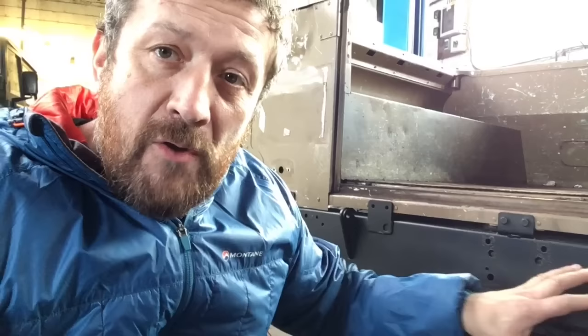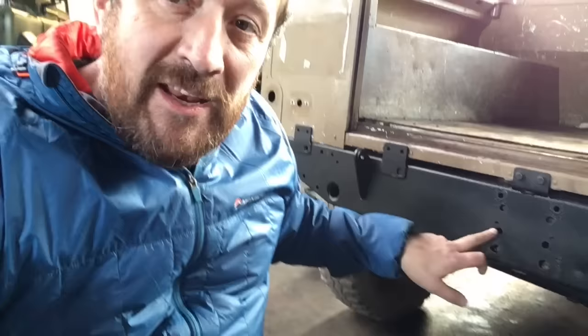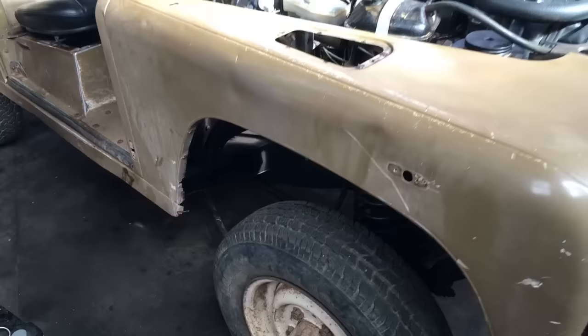At the back of the Defender there's a huge steel crossmember, and it's a really key point because they corrode really badly. Mud gets trapped inside and they rot from the inside out. People try to cover it with fiberglass, which isn't great and it will be an MOT failure. If you're towing from the vehicle it's really key that this is sound and solid. You can replace a third of the chassis from the back, including the spring hangers, as one piece — but you're looking at about £450 for the part and about £600 to have it fitted, so around £1,000 total. Factor that into the price.